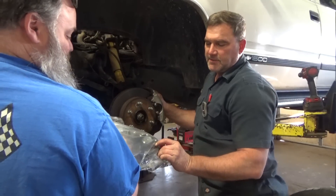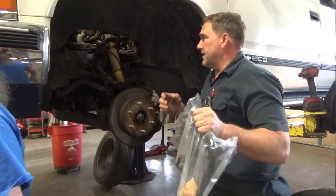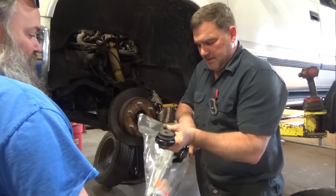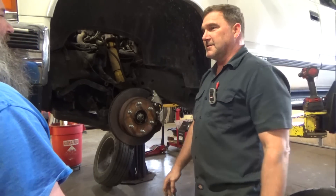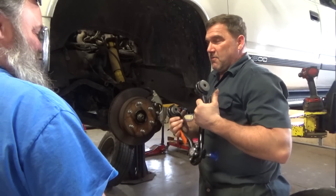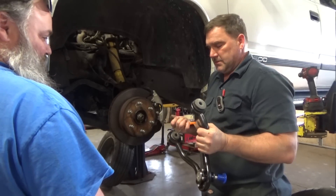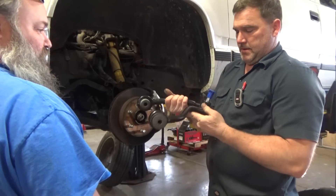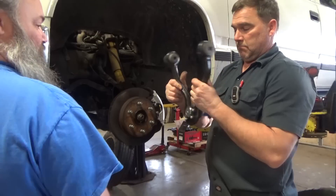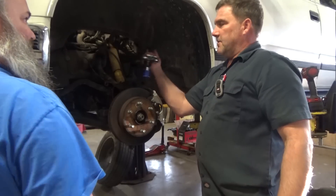One should have a bolt in it, or a hole. Yeah, it's got the hole in it for the sensor tab. I mean, you have to redo the alignment anyway, because when you take these eccentric bolts out — these are what your alignment settings are done by. Normally I would mark them and put them back in the same place, but seeing as how it's off by three degrees plus of caster and a full degree of camber, they're not going to be right. I'm just going to start over. I'll square them up dead center on all four, get a baseline, and then tweak it from there. I don't know why you'd even bother busting that ball joint off there — just buy a whole new control arm and put it in. It's cheaper and a whole lot less annoying. It's a lot easier to do a control arm — zip that off, bang bang bang, pull it out.